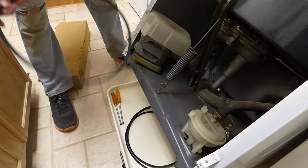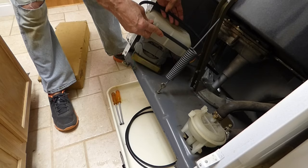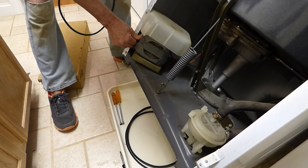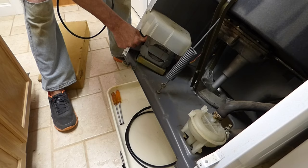This new drive belt is going to go to the transmission pulley and then to the motor underneath. When it's installed it should be snug, but not pulling on the motor at all. The wrong belt that I put on — the motor was stressed all the way in, there was no movement.